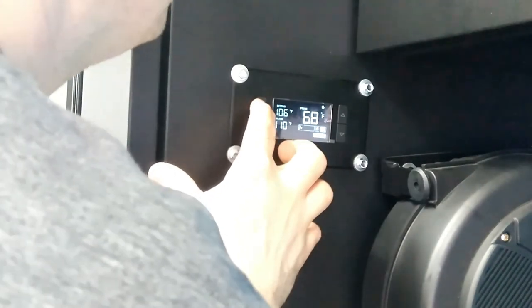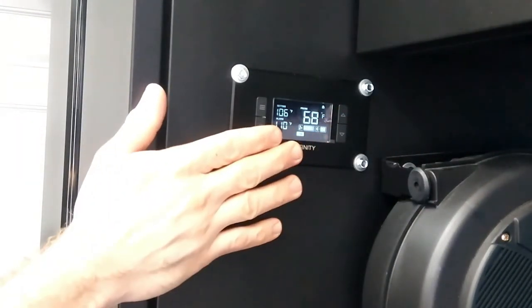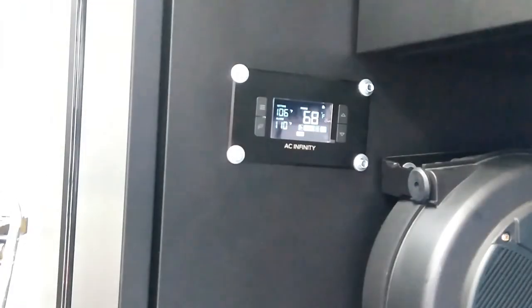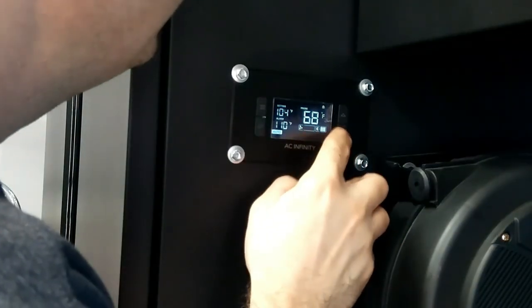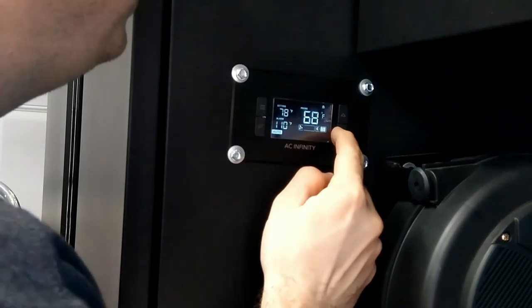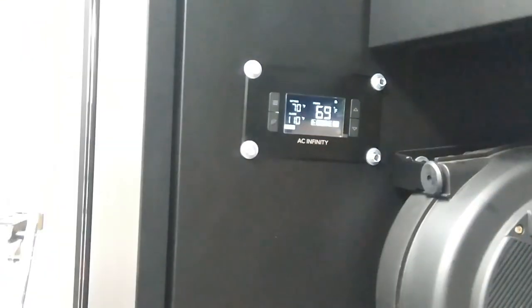Now we're just going to shut the fans off. Oh, you can adjust the level of the fans, the speed of them. Oh, wow, what a difference. Okay, so that's not loud at all. What we're going to do is shut them off. We're going to set this to auto. We're going to let this computer stay inside the cabinet and see if that probe will get to 70 degrees and then kick on here. Okay, there we go. They turn on. When they shut off, I don't know.